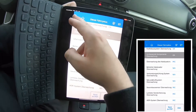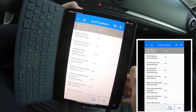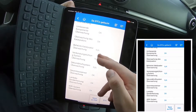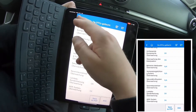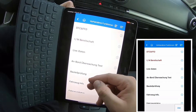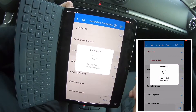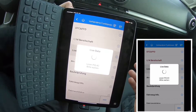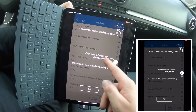The only thing you have to do is verify that the ignition is on, check that the Maxi AP200 connector is securely connected to the vehicle's DLC, then turn the ignition off and wait about 10 seconds, then turn the ignition back on and continue the operation. Verify the control module is not defective. It is easy to connect, and then you can have all the entire OBD2 scan functions available.